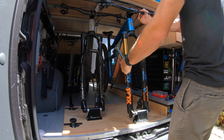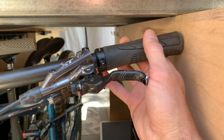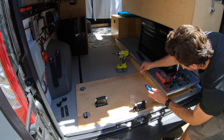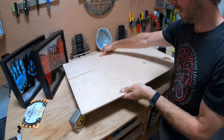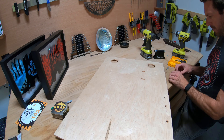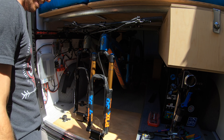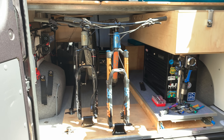Now that I'm carrying two bikes in the van a lot, I realize that I totally blew up the measurement of getting the handlebars away from my big ol' box. I can't move the box over to the right because I'm using that vacant area for my charging station, so I had to drill new holes in the rocky mounts and get it moved over about 2.5 inches. I took my time, took all the hardware off, drilled two new holes, hit them with countersink bits so my bolts would lay flush. Got everything mounted back up and it is looking so good. Plenty of room, the bikes are not going to hit each other, and you've got the clearance against the box — no funkiness. You can get the bikes in and out super smooth.